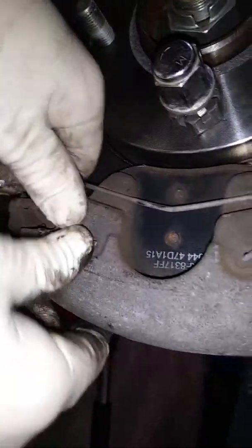Dust caps on there so we can keep all that grease in. Dust caps, okay. And then we gotta put that spring on the front, remember? Yeah. Alright, so to get this spring on, it's kind of tricky. You wanna put it in this first hole here, then you wanna put it in the second hole, like that, and you make sure you got this in the correct location on the caliper bracket. Once you get that on there, then you pull this part over to where this one is. Like so, and then it goes in there. Okay, I see. It kicks over. Mm-hmm. And that's all there is to it. Now we got to go do the other side. All right, rotor's on.